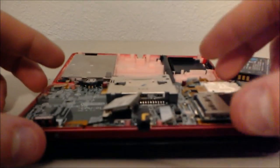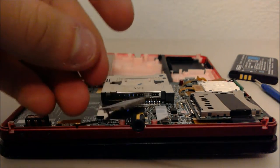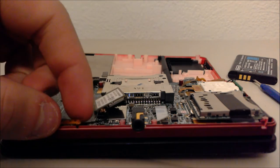Put it back out here, and usually, if you look here, this is the main problem right here. This card is usually off-centered, or got removed from this. This is the Wi-Fi card. Or, either this wire sometimes is off like this.